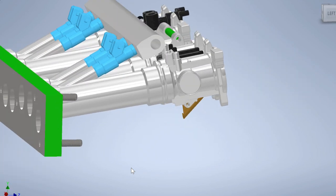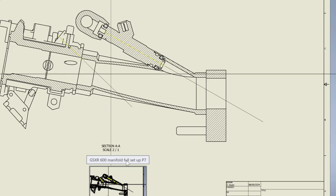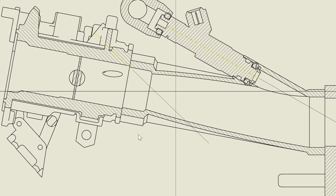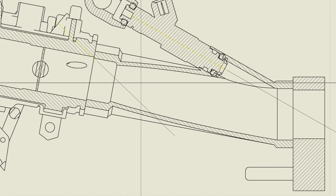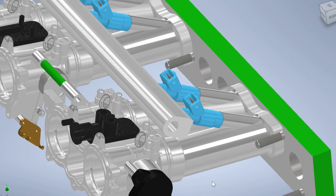Back on the laptop - I've made the runners slightly longer and increased the angle. Looking at the cylinder head, the ports run at about 12 degrees so I'm going to try and match that. I've also looked at the injector angle - what I'm trying to do is get it to fire as close to the valve stem as I can. I think I've got it right, though I should probably do some testing on this and need to work out how to make a test rig. I'm not going to use the ports on the throttle bodies because the angle is too strong. I've ordered injector bosses online - that saves having to make them - and I'll cut them to the right angle. Let's get it printed.